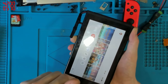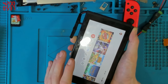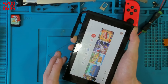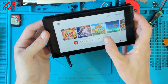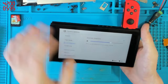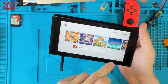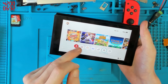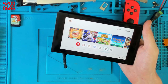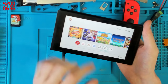Realistically, with the screen connected, with the backlight connected and everything else, when the screen is actually on and showing, it should be drawing closer to an amp, and sometimes just over an amp. So I'm going to check the screen brightness and make sure that's not what's causing that. That's maximum brightness, and even still, that's not quite drawing what I would expect — 4.2 volts, 700 milliamps roughly when it's in use.